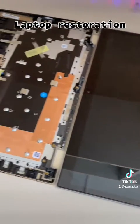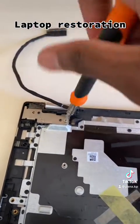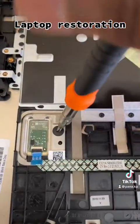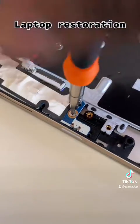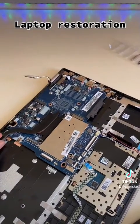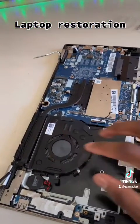Let's put them in the new donor. Let's start off by screwing back in the screen, screw back in the fingerprint reader, screw back in the USB power PCB, install back in the motherboard, install the fan.